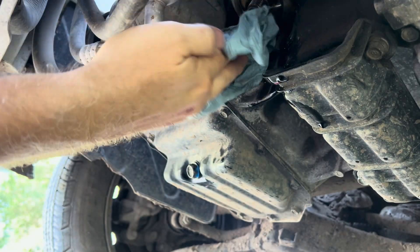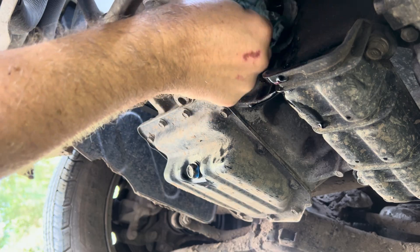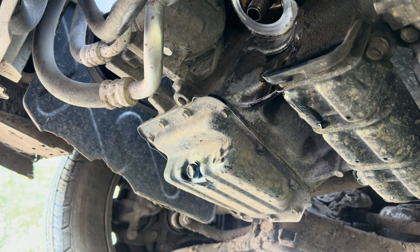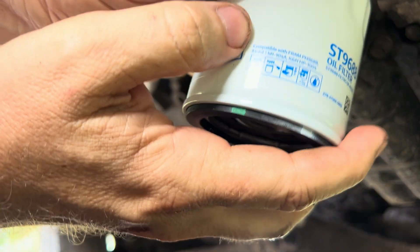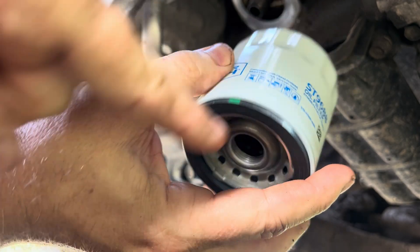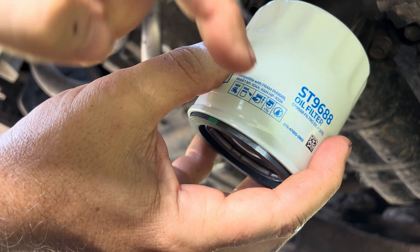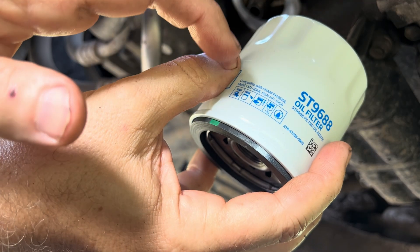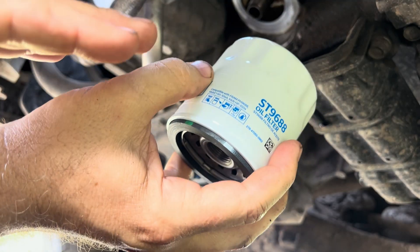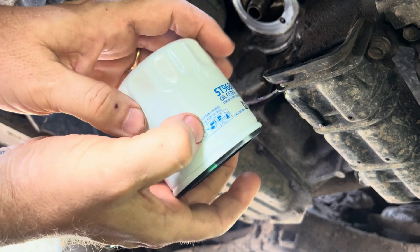Before reinstalling the oil filter I like to wipe this surface off just in case there's any grime or debris — there's no reason to have this ever leak. Now before putting a filter on I want to share a pro tip I was taught in school: follow the directions. It shows you to wipe it off, put a little bit of oil on the seal, screw it on until it just makes contact — not tight — and then turn it three-quarters of a turn and there will be no oil leaks. If you do it this way, next time you get in here to change the oil you could probably loosen it by hand. It works that well and it doesn't leak.